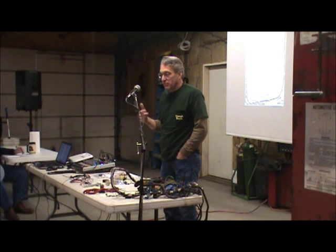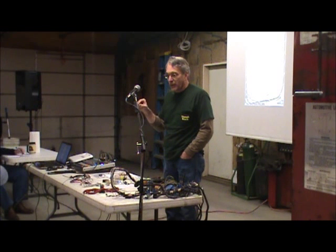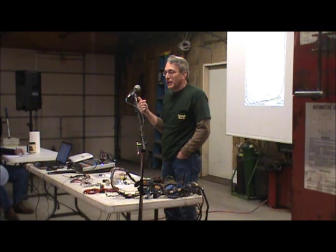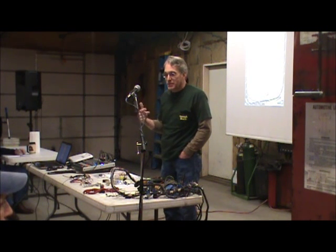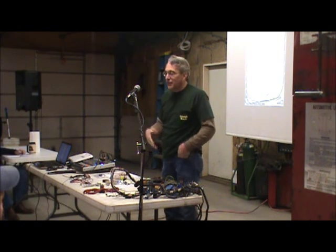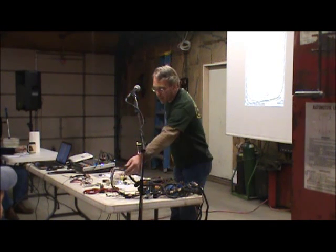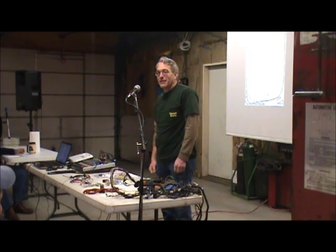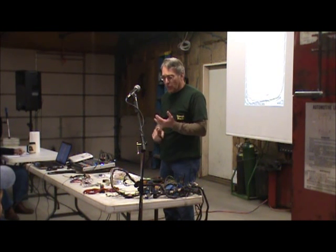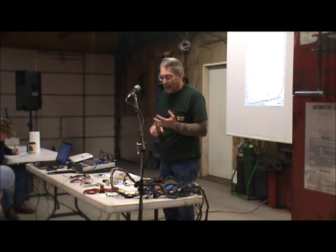There was an issue about 2 years ago with fuses that were rated at a certain current rating to fail, yet didn't. And I saw a little movie of a test somebody was running where the wire is actually starting to turn black. And the fuse could care less. And they're watching an ammeter go up to 40 or 50 amps on a wire that size. That's not going to last very long. So that's the failure mode. So either the wrong fuse is in there, or the fuse doesn't have a correct rating. It's not what the engineer called out.